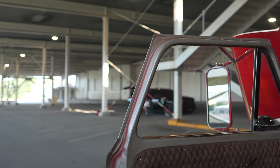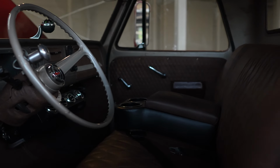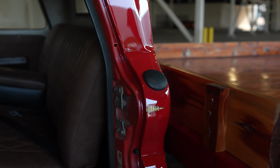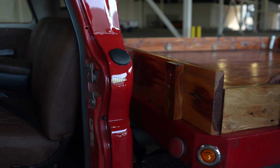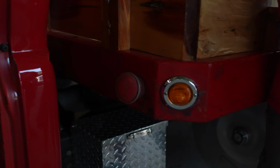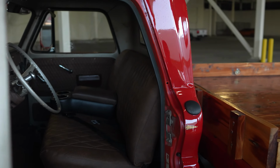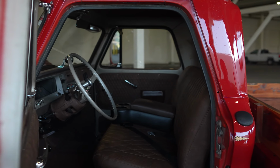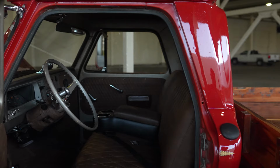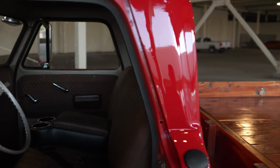I see here that it has the factory fuel fill would have been right here on the cab. The factory cap, but you got it here. Yeah. The fire truck actually had its own auxiliary tank and never had a tank behind the seat. So you got extra room back there to put that seat back. Yeah, because you're a tall guy. I see you got the electronic pedal too, the Duramax pedal, because that's all fly by wire. All the pedals and the mounting bolt through the firewall, because it bolts to the hydro boost. It's a big bracket, so it sandwiches between there.